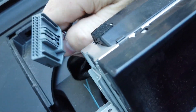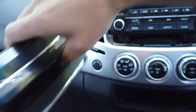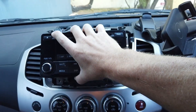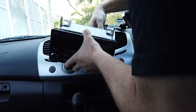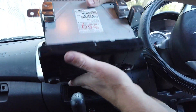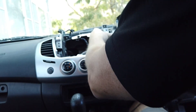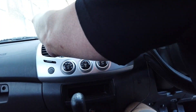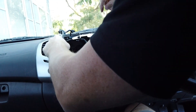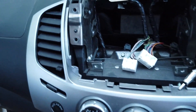I've also taken out two screws here at the back and unplugged the trip computer — push down and pull out. Here's our trip computer coming off, and here's our radio which now pulls out. Take off the plugs. In hindsight, I unscrewed some I didn't actually have to — it was just one, two, three, four, five, six screws that had to come out, not these two here. Those are all our plugs.